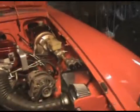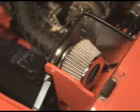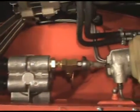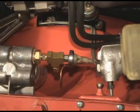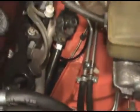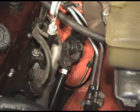The cold air box fits beautifully — uses the radiator bolts itself to lock it in. Two holes down the bottom let the air in and don't let the water hit the filter, hopefully. Fuel lines in, remote filters in. Pressure sensor with a mechanical line going up to the mechanical gauge on the dash. Speedometer cables in — I actually found a 90-degree adapter for the speedometer line. It fits beautifully, snakes in, it's out of the way, doesn't even have to be fastened; it naturally stays away from everything.